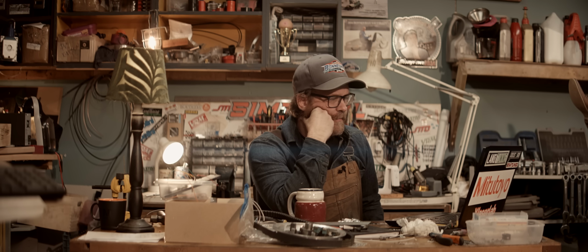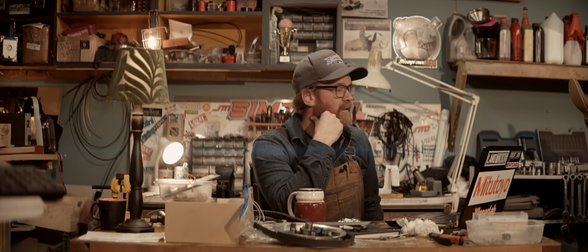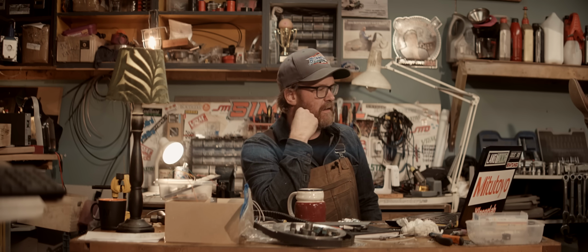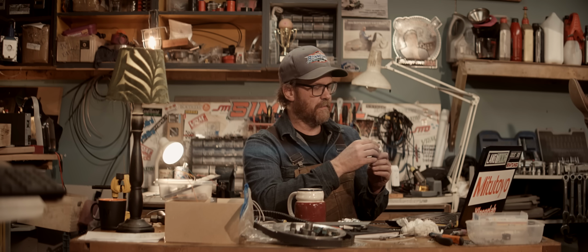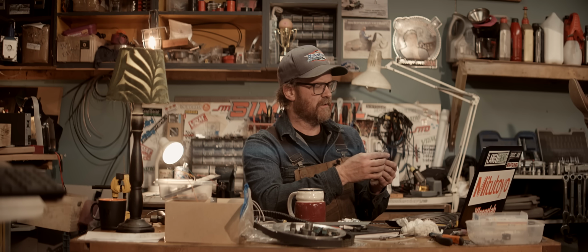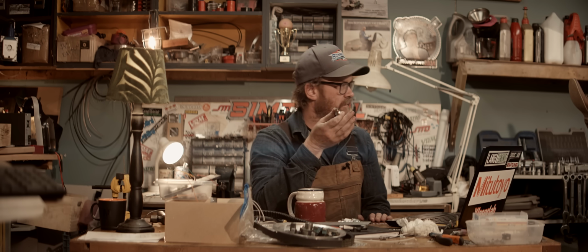I'm starting to think the Ignitec unit can't do this much timing at this high RPM. The plug looks fine. The timing mark, what I think is the timing mark, is in the bend, which is like optimal. People say that's optimal. And it's halfway kind of bluish, halfway kind of yellowish burnt. There's a little bit of heat down into the threads now, but there's no sign of melting. Remove the main jet completely, do a run, and see how it behaves.